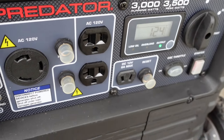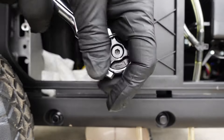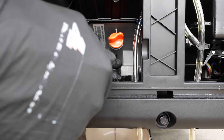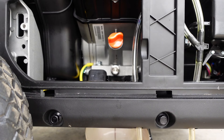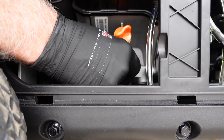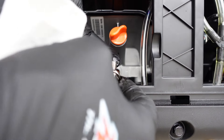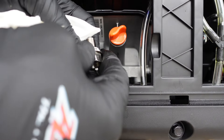We'll get that all draining. Definitely don't want to drop it, because it'll pick up any kind of ferrous material. This magnetic drain plug even has a hole drilled into the hex head to safety wire — I thought that was pretty cool. The gasket came off, and I can see right now the magnet has nothing on it.